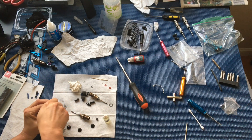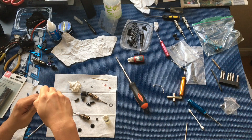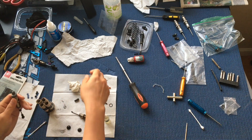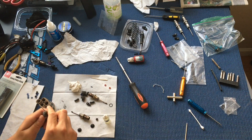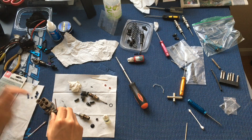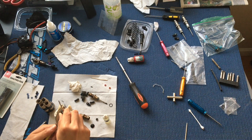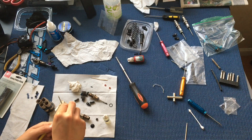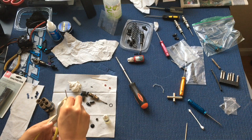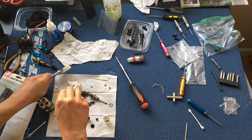We're placing the shock into our homemade shock holder and popping off the cap. If you're going to use pliers on these metal-body shocks, make sure you have some masking tape or similar tape on the jaws just to prevent any marring on the body of the shock.